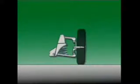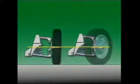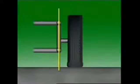When the wheels are in the straight ahead position, the ends of the stub axles are almost horizontal. When the wheels turn to either side, the effective steering axis inclination tends to make the ends of the stub axle move downward, but this is prevented by the wheel. The stub axle carrier then must move up, which raises the front of the vehicle. When the steering wheel is released, the mass of the vehicle forces the stub carrier back down, which pushes the wheels back to a central position. With a vertical steering axis, no self-centering would occur.